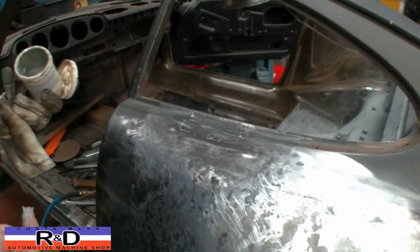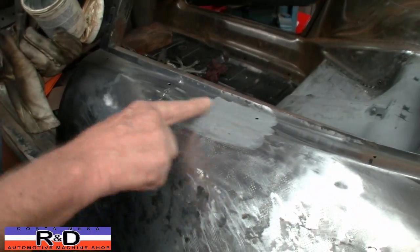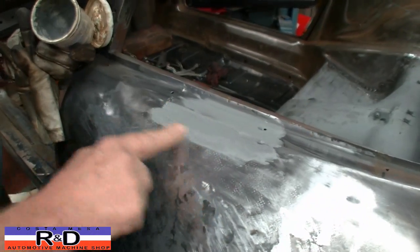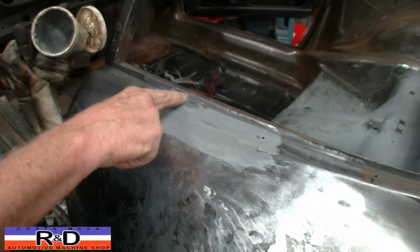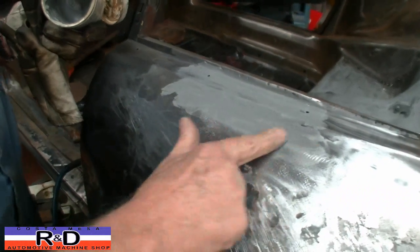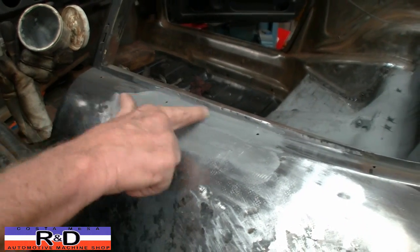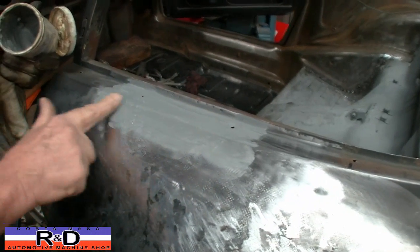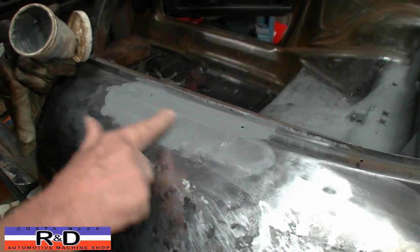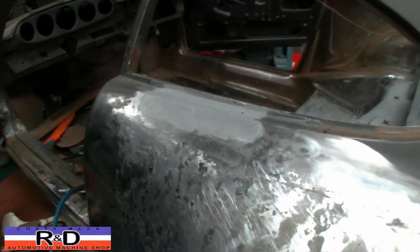And clean. Now we're going to put some flux paste, which is based on tin paste and flux. When we heat it up, that will clean up the remaining metal, and it will prepare the surface with the tin. So we put a little bit. In lingo they call it body butter. What that means, I don't know. Okay, it's pretty well spread now.